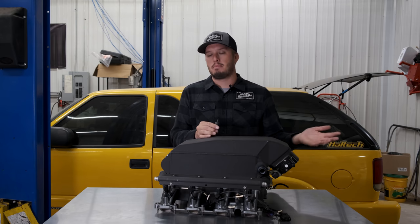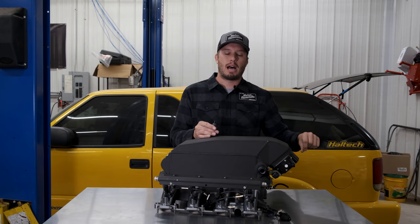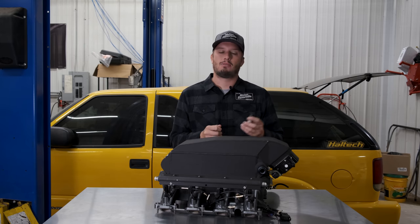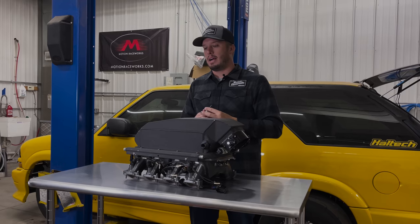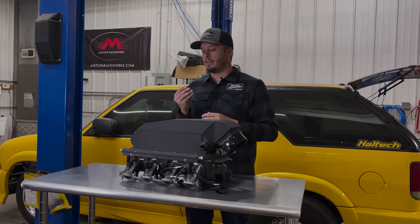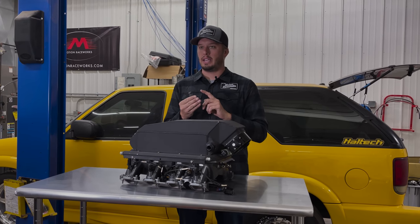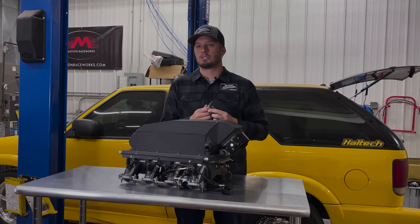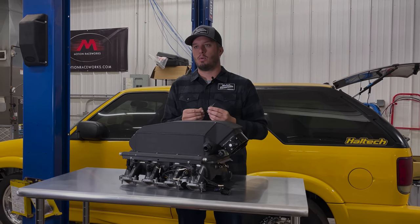On an air-to-air setup that's up front, you could have the sensor on the pipe coming into the throttle body. A lot of factory style intakes don't have a spot for an intake air temp sensor, and that's okay. I just prefer to have it right in the intake. If you have an aftermarket intake and can fit one in, we sell these Rife sensors in eighth, quarter, three-eighths, and metric thread patterns — I'll put a link in the description — and we have a variety of different wiring options.